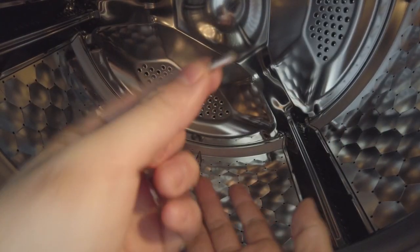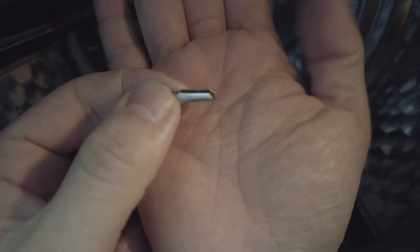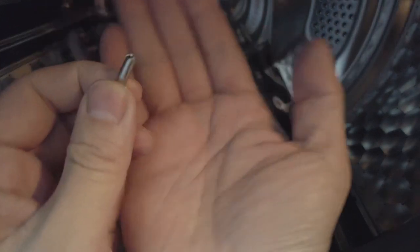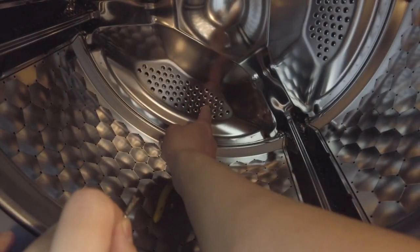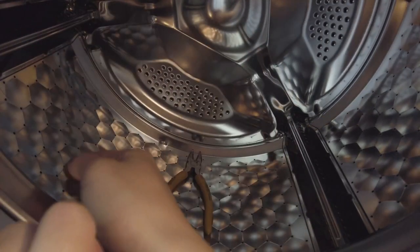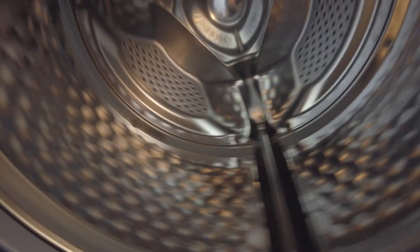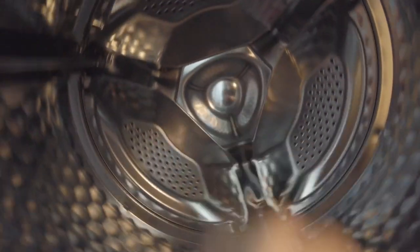So I've managed to get the little metal bit out. It is just a tip of a string for a hoodie. If you have anything that can be dislodged like this, just check the little tiny metal holes and see if there's something scraping against the back stuck inside. If I rotate the drum now, this is working fine — all working perfectly fine now.